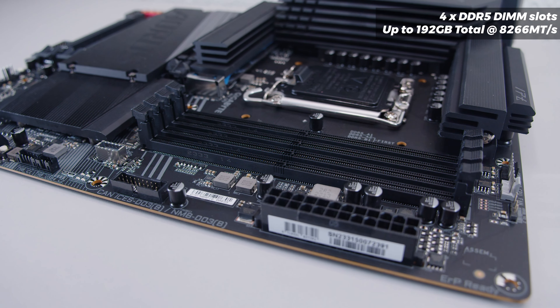I hope you enjoyed this first look at the new board from Gigabyte. There's a nice selection of quality of life changes that I personally think should trickle down to every motherboard, not just Gigabyte boards. Especially tool-less M.2 installation — we've had tool-less M.2 for a couple of years, but not to the point where even the heatsinks are tool-less. That's really cool. Also on the backside of the board, there's extra support and a shield around the top PCIe slot to add rigidity, especially for those newer 40-series GPUs with all the sagginess going on.